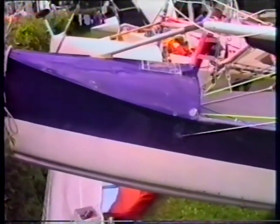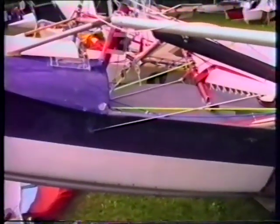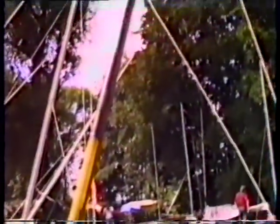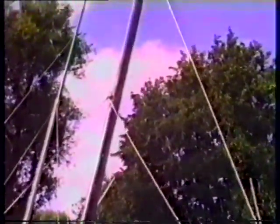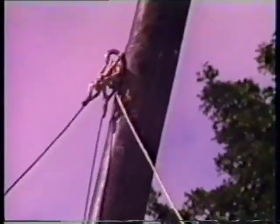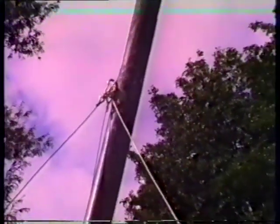The arrangement consists of a forward prodder that goes down into the deck. The forward deck is domed and he has a very small flare to stop him nosediving downwind. The boat is extremely narrow — close to one foot wide on the water line. He's done away with the prodder system and has three stays up to the prodder staying point, and apparently that's more effective than having the prodder itself. It stops the rotating mast bending sideways in the middle, so it remains dead vertical all the time.